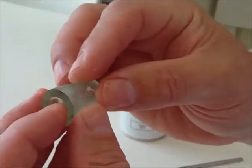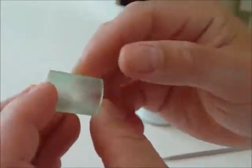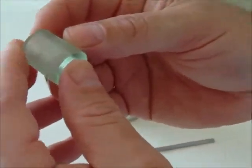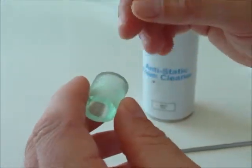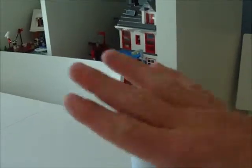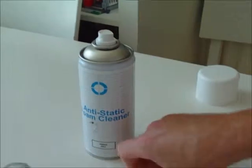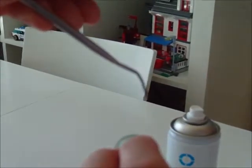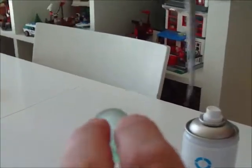Now, these tires do have an apparent direction, and if no one's ever shown you how to tell directionality in a tire, think of it as a saw blade on a circular saw. The tines should be going into the paper path. So this would be the curve. We want them to be like this as they're going onto the paper.